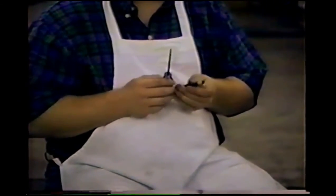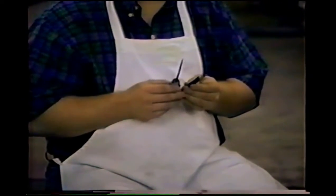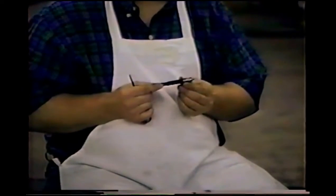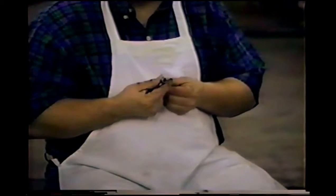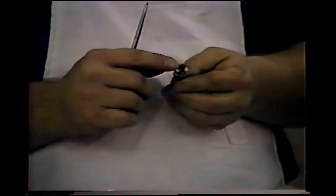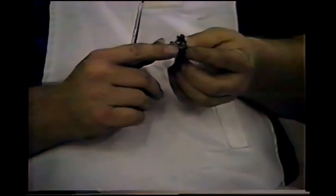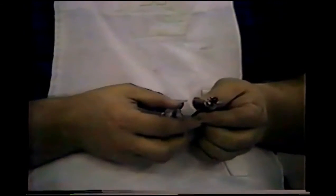Sometimes there are dents that you cannot get to without drilling a hole on an interior panel. To do this, I feel the best way is to use what's called a spot weld cutter. It has a pilot with a cutter. You use an awl with a nice solid shaft and tap a hole in the metal and then drill a half inch hole into the metal, and through that hole we can insert one of our bars made out of 3/8 inch thick metal or any of our screwdrivers.